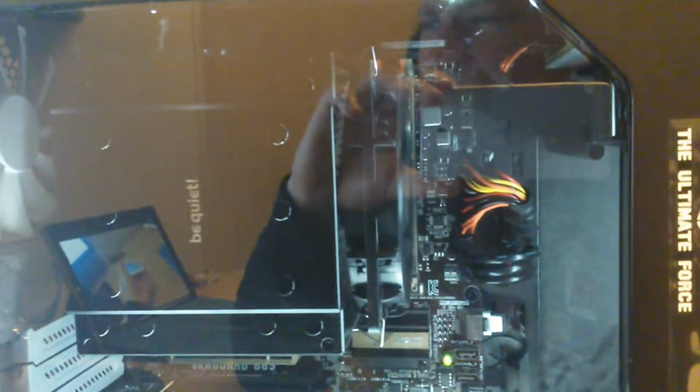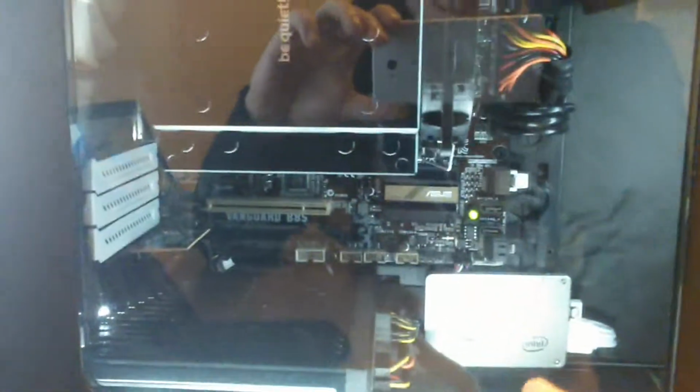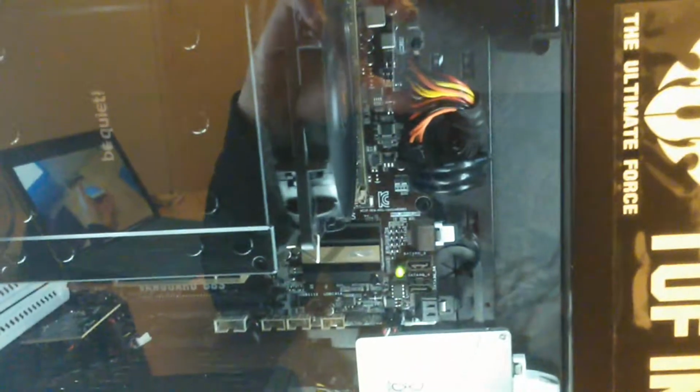I have the i7 4771 in there, with 3.5 gigahertz and 3.9 gigahertz boost. I updated the BIOS on the motherboard, and then the boost doesn't go anymore. I mean, it works. It's stuck at 3.7, sometimes 3.8, but it doesn't go up to 3.9 gigahertz anymore. It's really strange. I contacted them, and they made an update especially for me. It was really nice, but it still didn't work. But I don't care. It works fine. I just have to switch the motherboard if I have money.